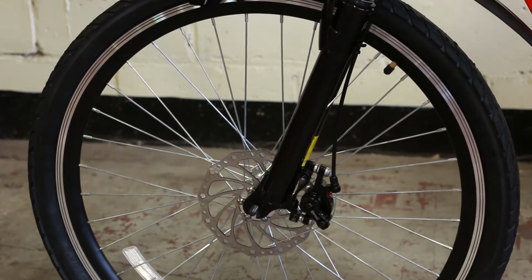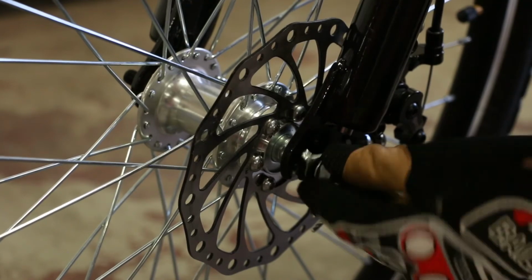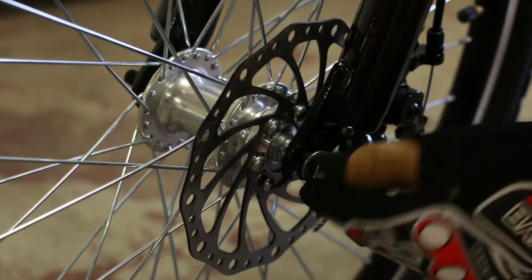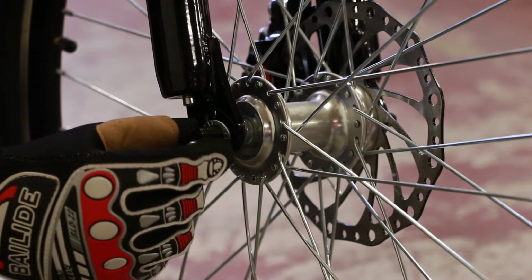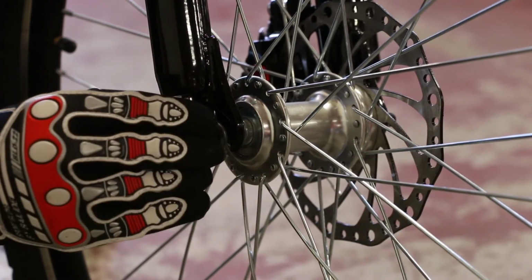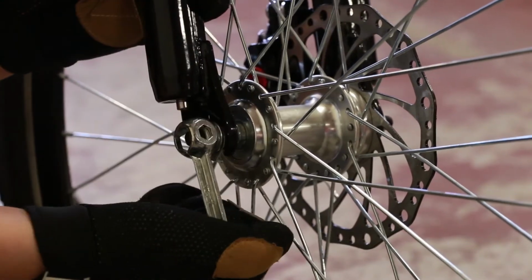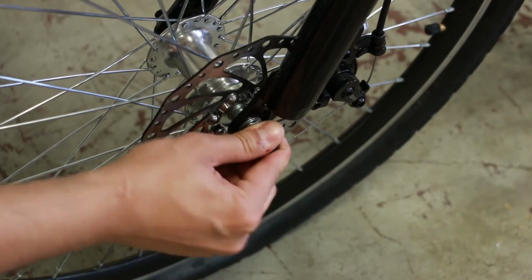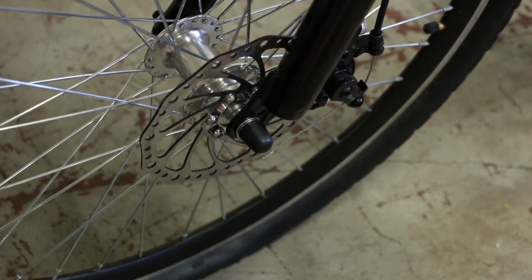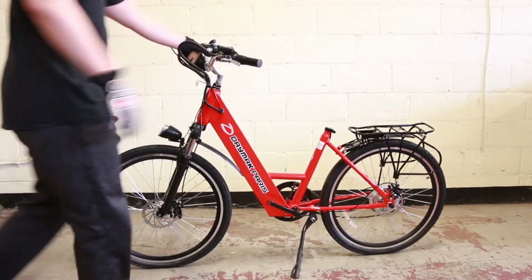Make sure the disc on the tire is on the left side where the brake disc is located. Replace the washer upside down and tighten with the multi-wrench. Place the plastic nubs located in the Daymak box over the nuts. At this point, rest the bike on the kickstand.